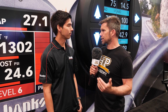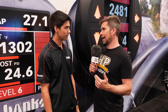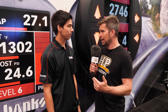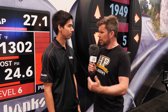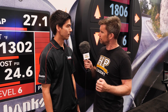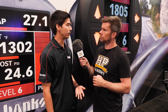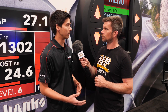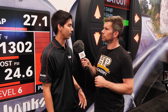The L5P, which is the latest generation of GM's 6.6-litre V8 diesel turbo engine, is a case in point. When it was originally released it wasn't something that could be tuned — that's mostly the encryption. Eventually someone found out that you can crack open the ECU and go through a pretty extensive process to replace some of the components to actually get past that.